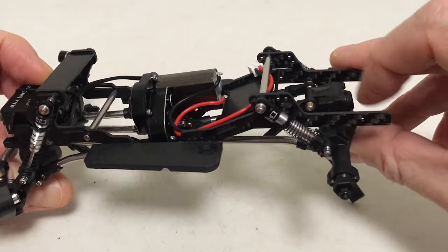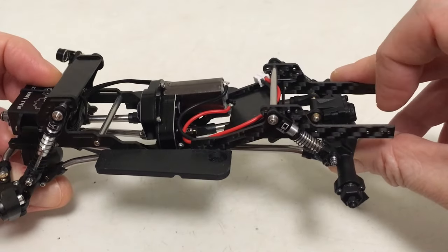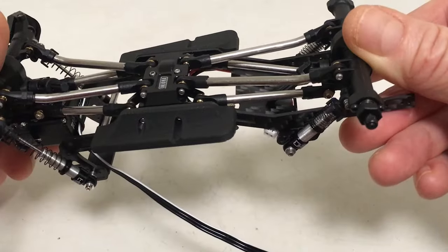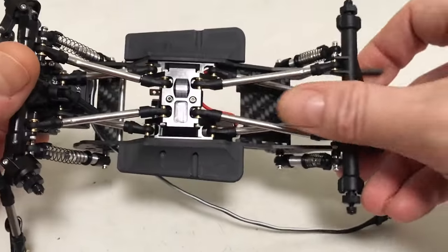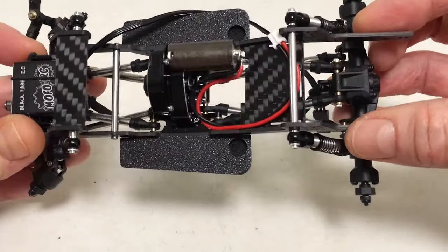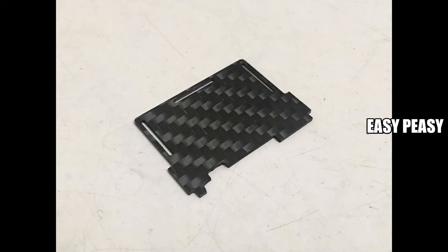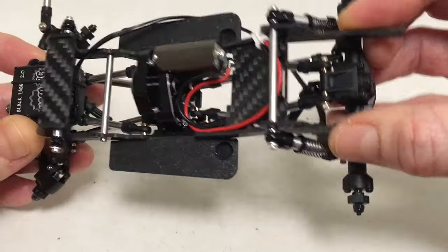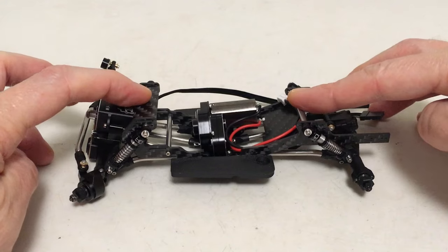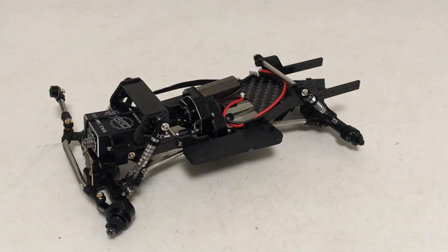But you can imagine if I had that link riser, that would push the axle down because the links can't get any taller right here. So removing that solved the problem. My uppers are right there at the tray. So if the drive shaft has any conflict with the tray, I can modify that down the road. Already had to do a little mod there for the wire connection at the motor. But other than that, smooth sailing there on the rear. Everything is sitting nice and low and even at full compression. So very happy with the slider thus far.